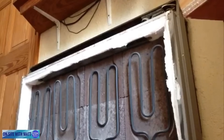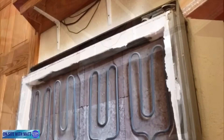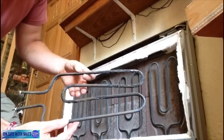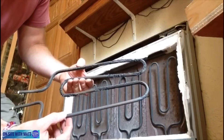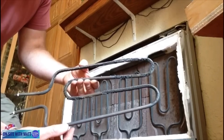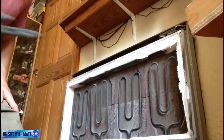There's absolutely nothing wrong with those elements. I'll just turn it down and off. This is an element I replaced several weeks ago from another storage heater - I thought that might have been the problem here, so I brought some spare elements. You can see it's quite obvious to tell if an element is broken just by visually looking at it. You can see these current ones are all in pretty good condition.